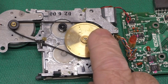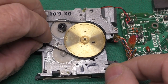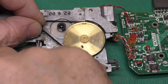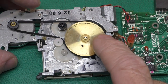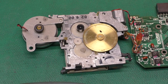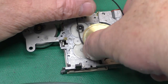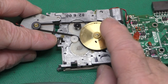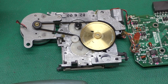I measured the cross section of the belt with calipers, but that's kind of tricky with something that's squishy, and with an old piece of rubber you don't know how much it has shrunk over time or how much you're squeezing it with the calipers. If anything it feels a little loose - yeah, that's still awfully floppy, I don't think this belt is going to work. As if by magic, a week goes by and a new belt shows up that's a little shorter. This is a six-inch long belt and the tension is much better, and the profile is even good - I think we've got a winner. I'll put the part number in the description down below.